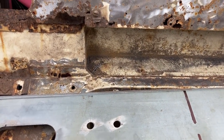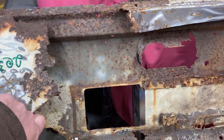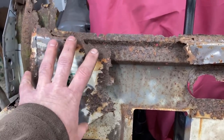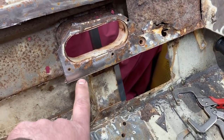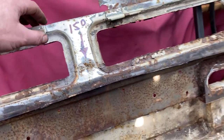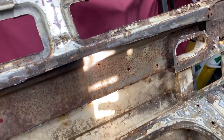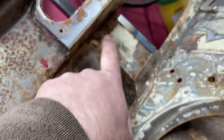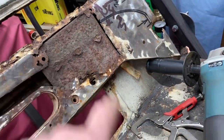So I'm going to clean that face up, make sure I've got some steel to weld to, take this bit off back to here, and then all that's left is this top front here and the new piece will run straight across. So I've got to nick it and sit it either side of there, then take all this back to here. I'm just starting to chew away on the inside — sorry, the front face of the vent flap seal area. So I want to take that off and leave the inside, because that's actually good. I've left myself what I hope is enough material around there to be able to cut out and join up to it.